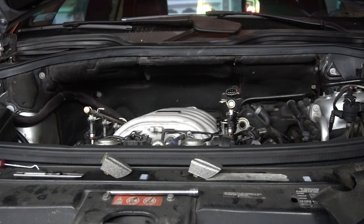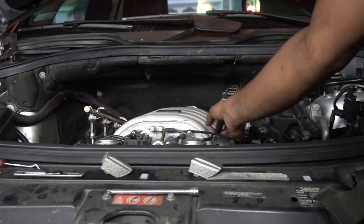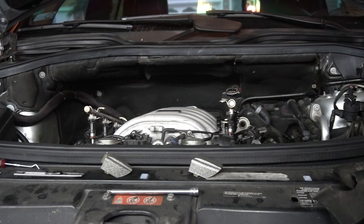Before putting the fuel injectors back in, get some Q-tips and just clean out the little ports where the injectors go. I'm not going to go too hard on this because I'll eventually be putting a catch can in, which will involve taking the intake manifold off anyway. So I'll use a Q-tip with some intake cleaner to knock down the carbon buildup and have a better place to seat the injectors. Reassembly is pretty much the exact same process but in reverse — just be careful with the vacuum line. Make sure to tighten that fuel line down really well, and before you start the car, definitely prime the pump a few times by cycling the ignition a couple of times before actually starting it, otherwise it will misfire because the fuel rail is empty.